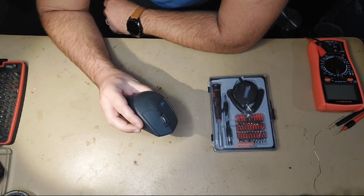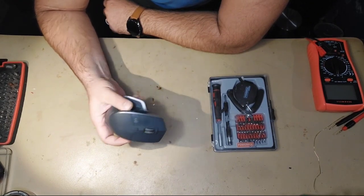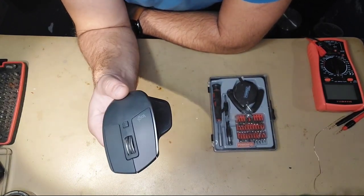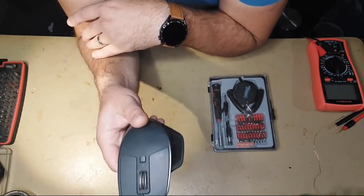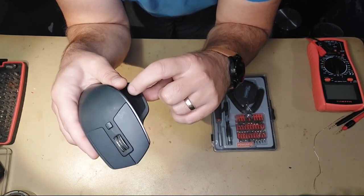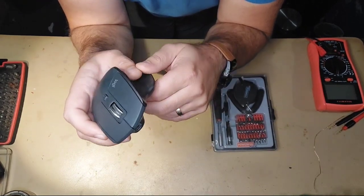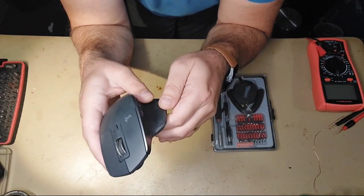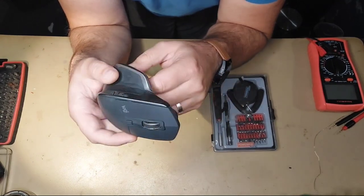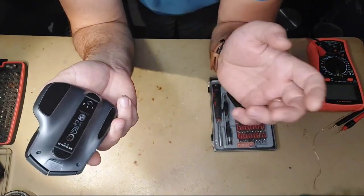This is my daily driver. I needed to edit videos and stuff like that, so I cannot afford to not use it. I love this mouse so I have to use it. Right from the beginning I'll tell you exactly what the problem is and how to fix it. The problem is that a gesture is activated. Usually if you click on this thumb button here and hold it for a period of time, the cursor will get stuck and a gesture will pop up. But in this case it's stuck due to aging and the cursor is not gliding on the screen anymore.